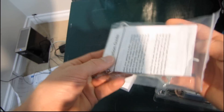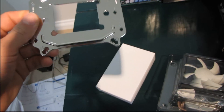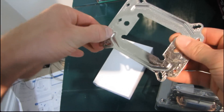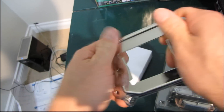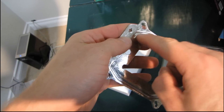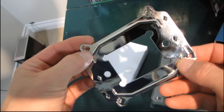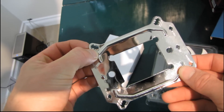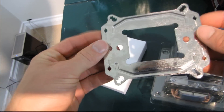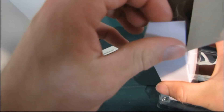Let's have a look at the back plate for their new universal mounting system. That's nice and solid. You can see they've actually shaped it — there's a groove in here — to give it a bit more structural rigidity. They've also got a plastic coating on the back to keep it non-conductive when plastered to the back of a motherboard. There are holes for 775, 1156, 1366, AM2, AM3, and K8 — holes for pretty much everything you could want.